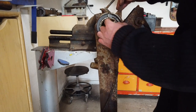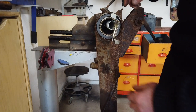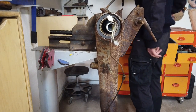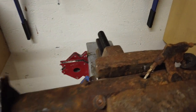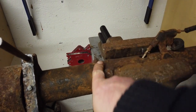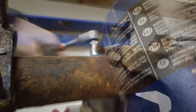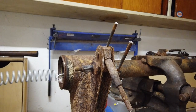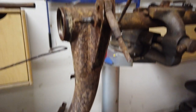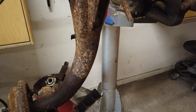What I'm going to do now is pull it out like this, because this is going to be changed. I got a brand new one, so I'm just going to cut it in here and then take it out. I'd also like to loosen up this nut because it holds the brake line inside the tube. You might notice it just snapped — out of shot, but it snapped down there by the drum brake. So it's about time to change these.